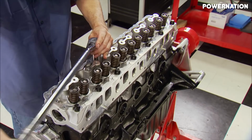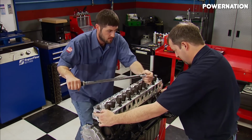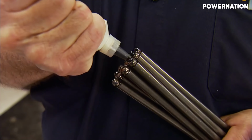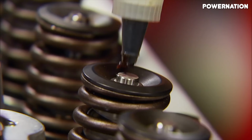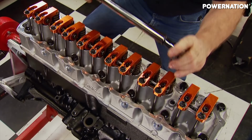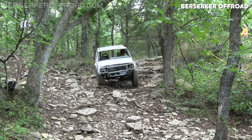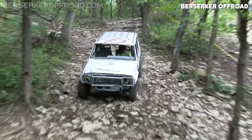This is evident by the fact that 4-liter heads will pretty much just bolt onto a 232 or 258 cubic inch AMC inline-six. What's even more interesting is that according to AMC historian Frank Swigert, sorry if I butchered your name, it's totally possible and relatively common to put a 258 cubic inch crank and rods in a 4-liter to make a 280 cubic inch engine. This can be done with stock 258 cubic inch crank and rods and a 4-liter block and pistons.